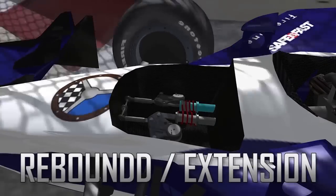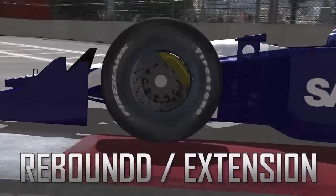And then there's the rebound side, or the extension of the damper, when the wheel is moving away from the body. To break it down simply: the rebound side of the damper controls the energy release out of the spring — controlling the major part of the car's mass. The bump side of the shock absorber controls the movement of the tire coming up into the suspension. First order, we think of rebound as controlling the mass of the car and bump controlling the energy in the tire.